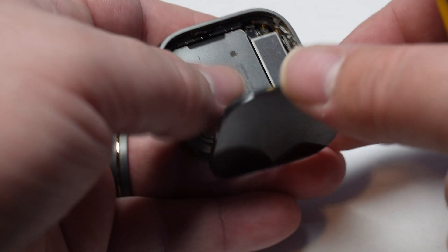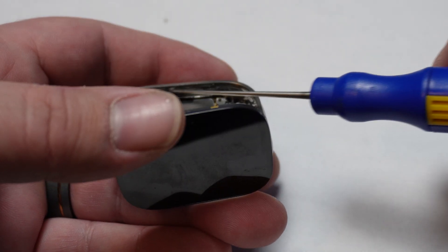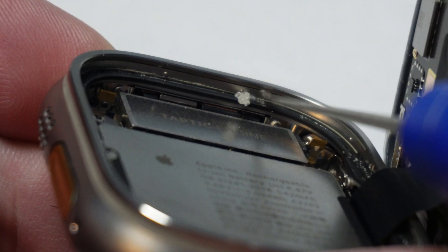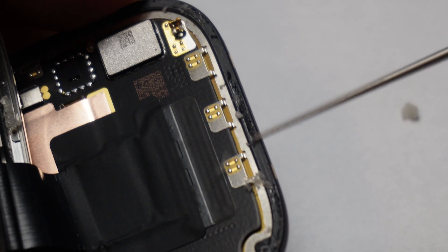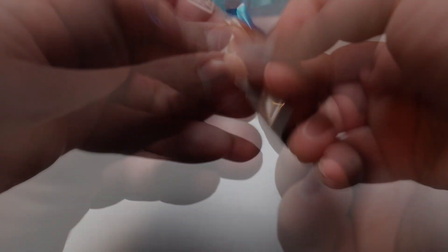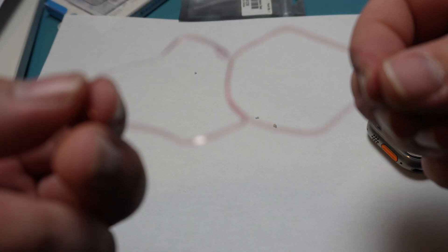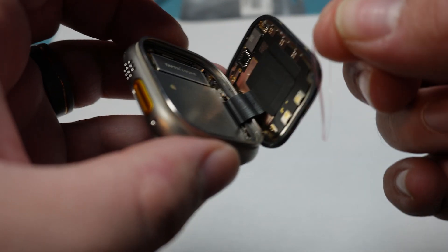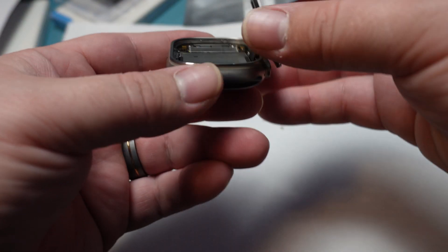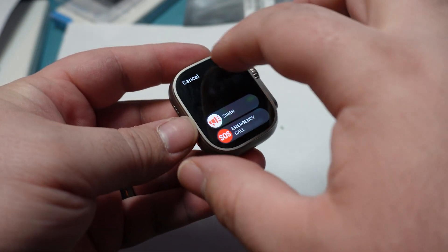To clean up the inside of the frame, I've got a tool that helps spin off the adhesive. Turn it on and it'll literally just pull the adhesive away as it rotates — it just whips it right up, making it very easy to clean. You can even do it on the display itself, you just have to be careful. Pull off all of the old adhesive really easily. We'll get out some new adhesive, peel away the rigid piece of plastic that keeps it intact, then peel away the protector for one side. Carefully maneuver this around the display so it comes around the flex, line it up on the inside, peel off the protector, and fully install it down inside. Put it under some pressure — and this watch is all done.